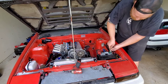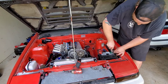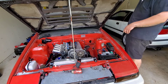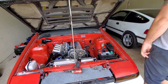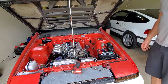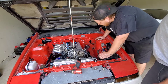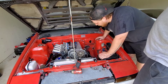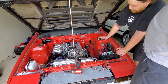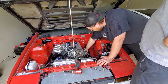Some people are going to tell me I should have done this first — those people don't even work on cars. Go buy an H6, torture yourself. You can't find parts and when you do, you pay six times as much as you would. So there's that. We're going to hook the multimeter up to the starter signal and see what's going on there, and probably also check the power wire to make sure there's no disconnect in between there just to be safe.